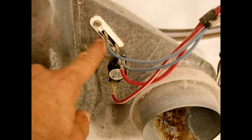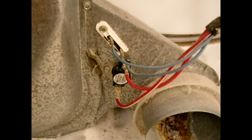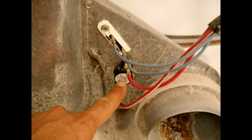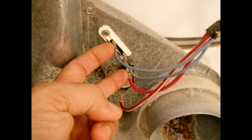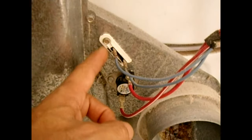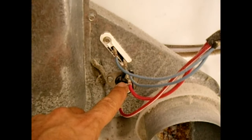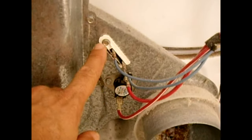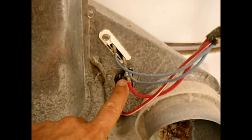Right above that is a white ceramic piece — that's the thermal fuse. It's also designed to blow when the temperature reaches a certain point, and it does not reset. Do a continuity test across these two terminals; you should have continuity. If you don't, it's faulty and must be replaced. Usually if the thermal fuse blows, it means the operating thermostat has stopped cutting off, allowing heat to rise too high. In my opinion, if you're going to change the thermal fuse, change the operating thermostat too — they're not very expensive and you can find good deals online.